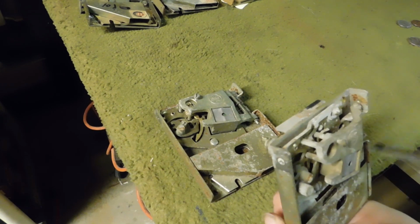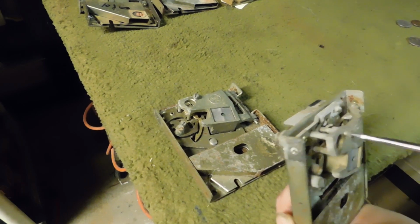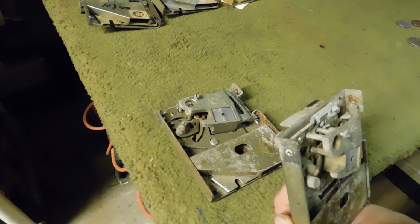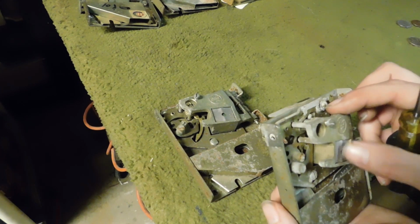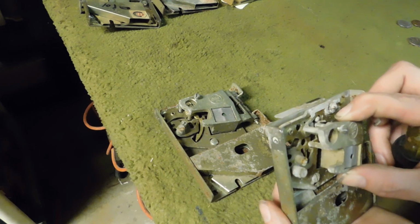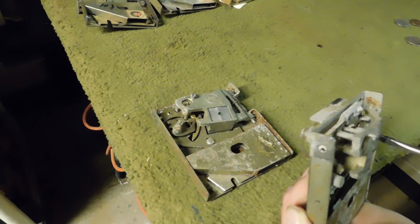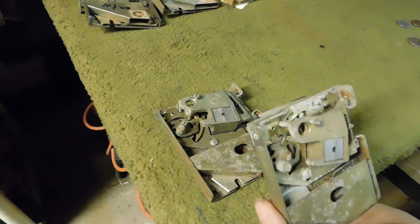So as you adjust this screw, what it's doing is it's pushing against the plate back here, so that as you tighten the screw, basically what's happening is this magnet is pulling away from the back of the plate, allowing a thicker coin to come through. And as you loosen it, like so, it makes that thinner.